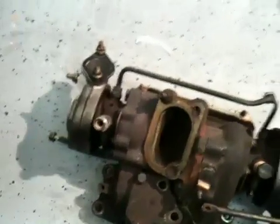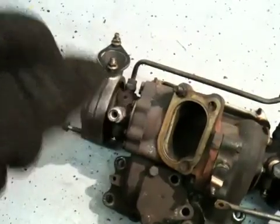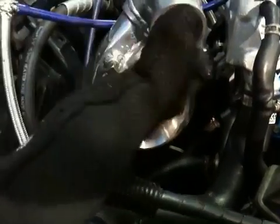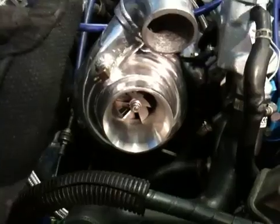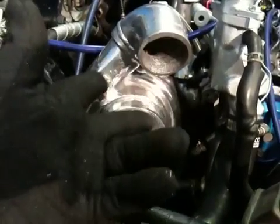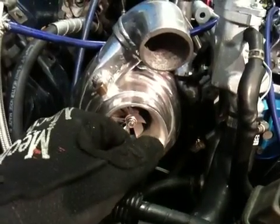Wrong. The second turbocharger actually has very hot air being created — or compressed — before it's ready to be used. There is an efficient area, and an area is a two-dimensional map. Think of a topographic map where there's a left, right, up, and down region where it's most efficient. So when you're picking the turbocharger you want to use, you pick out what you're looking for. You say: I want it to be this powerful at this RPM, produce this much boost — and then you put those points on a map and compare the maps for each turbocharger to find your best match.